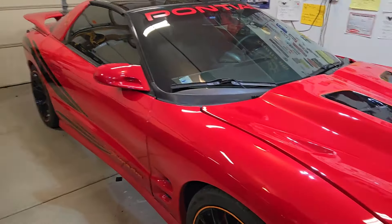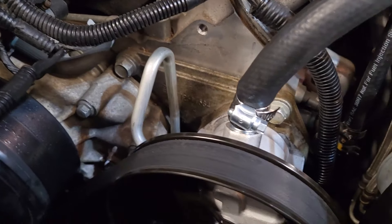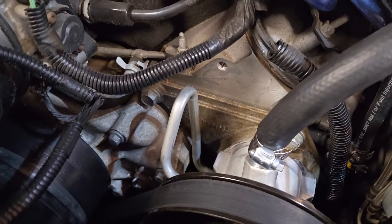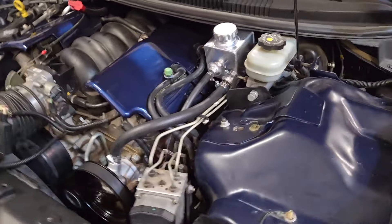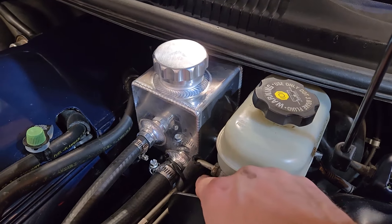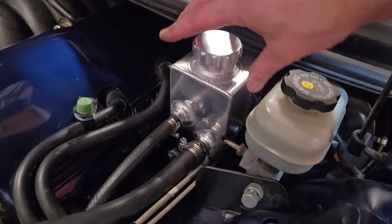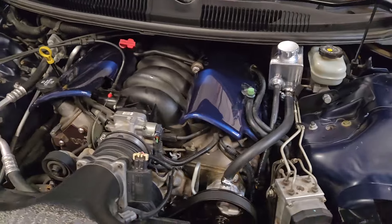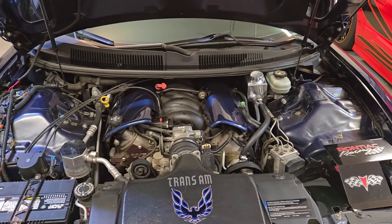I'm thinking about doing this exact same kit in black on my other car. I noticed in Nick's video there's another option — you can see this triangle bracket back there that the power steering pump attaches to. A company makes a billet polished aluminum version that looks amazing. This is my daily driver so I don't care as much on this car. One thing I did change: the reservoir was rattling a bit — the edge of the round part was rattling against the brake line. So I took an extra piece of vacuum line, kind of like a hot dog bun, slipped it over the brake line, cable-tied it on there, and now it doesn't move — a big improvement. If you need a power steering pump, I recommend this kit: really easy install, a nice upgrade, and you don't have to worry about remanufactured stock ones burning out quickly. It just looks better too.